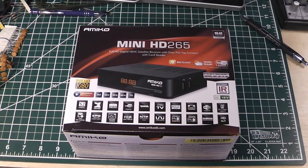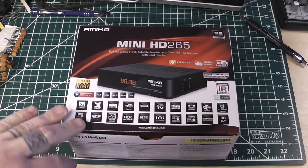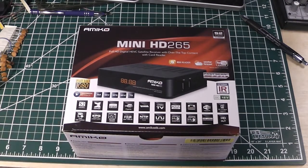This one here, I really notice a difference in the speed, but like I said, that's not the main selling point, because once you're watching TV or whatever, who cares about that? But it does do the H.265, and there is no noticeable increase in speed, which makes it a little easier and a little neater. And the blind scan speed is pretty reasonable on it. I did a 97 West at 2 minutes 16 seconds. Some of the older ones was like 5 minutes or so or whatever, so it does pretty good.